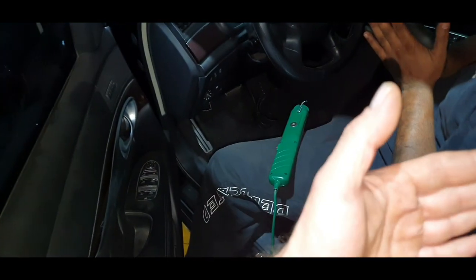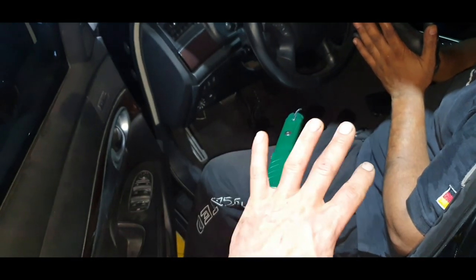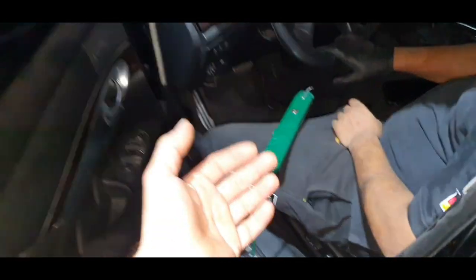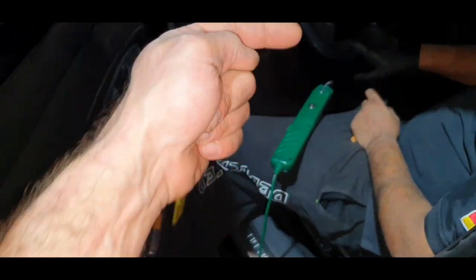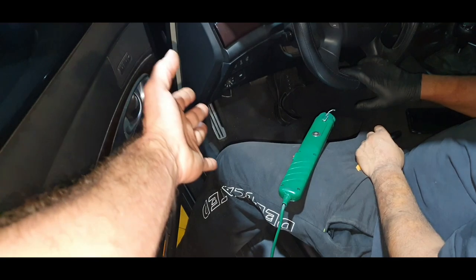Because this is one spacer that is coming. You're forgetting the clutch release bearing, you forget the pedal, you forget the master cylinder, because it's been already tested. With the previous clutch, they don't know the thickness. That's why I said you need to count how much the thickness of the previous clutch set is, because it's not a single clutch, it's 3-4 clutches, I don't remember how many.